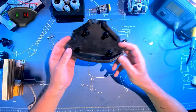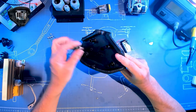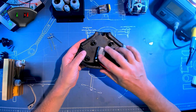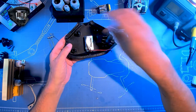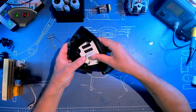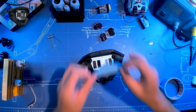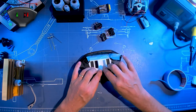Although it may seem simple to just cut three holes and put the switches in, you may want everything nice and center, and it can get pretty crowded inside if you want to fit the 9-volt battery as well. That's why we did this backplate. It serves both as a cutting guide and as a lock to keep the switches in place once they are installed. We first taped the backplate to the center pad to keep it in place.